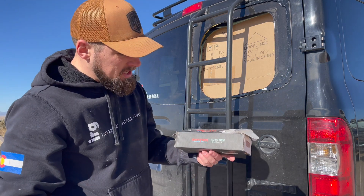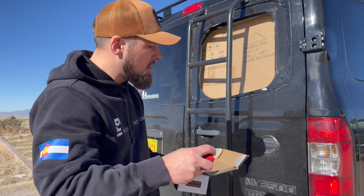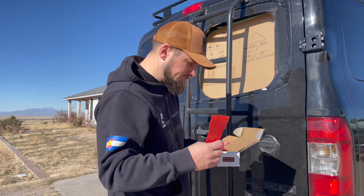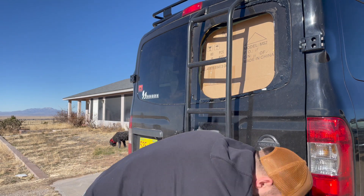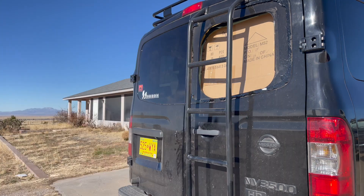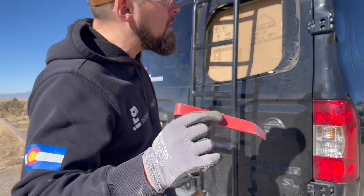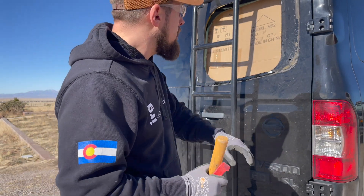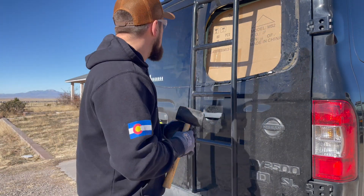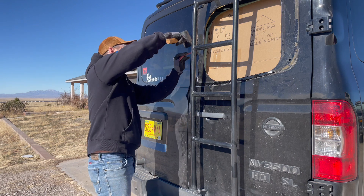I have some plastic auto trim removal kit pieces I'm going to use to scrape the remainder of this glass off the van. I have some plastic on the ground to catch debris. You should use gloves and safety glasses. I really highly recommend getting these plastic trim removal tools. A lot of people say to use razor blades, but that'll really mess up the paint. I've also got a rubber mallet because the urethane came off easy on one side but is really stuck over here, so I'm just gently getting behind it and tapping it.